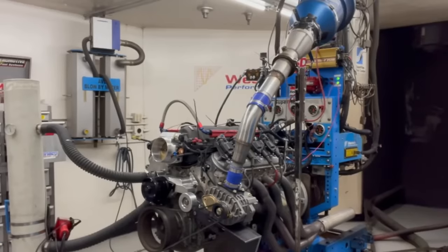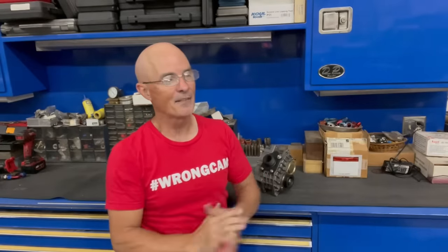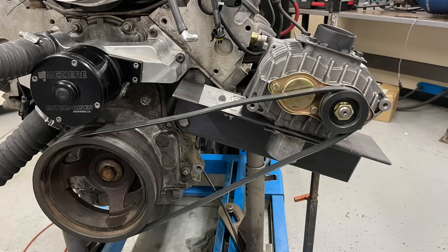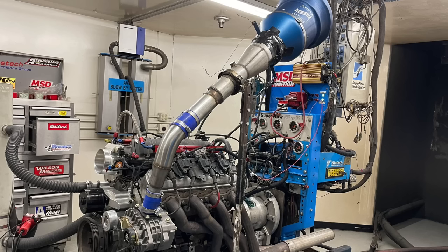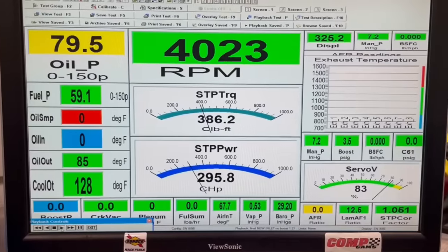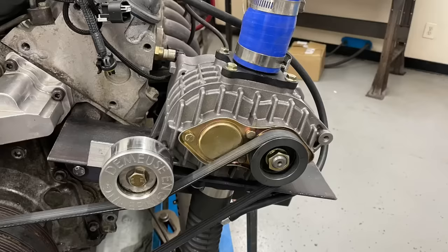That's right, you heard me right. I'm making a supercharger dyno. I've taken an LS motor. We're gonna spin this supercharger. We're gonna monitor the airflow going through the blower. We're gonna monitor the charge temperature coming out of the blower. And we're also going to monitor how much power it takes to drive the blower. That's right, the most exhaustive test ever on an AMR500.